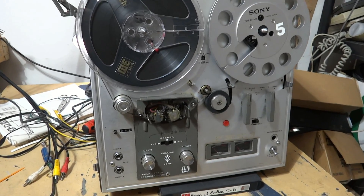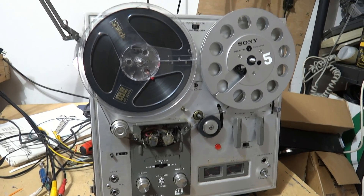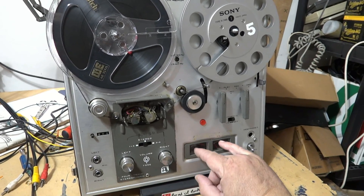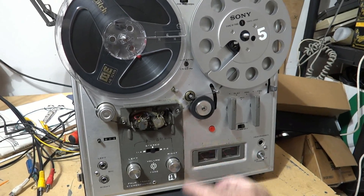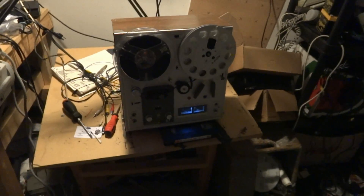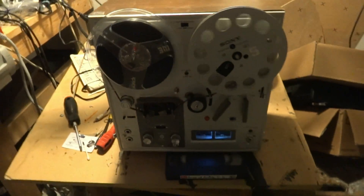There we go — a nice classic Akai 1710W vacuum tube amplifier tape recorder, stereo, still working after all these years. All it needed was a little cleaning of the controls and an upgrade from the light bulb to LEDs. Even though you don't see it here with all the bright lights on, it actually illuminates the meters quite nicely. I've dimmed the lights so you can see the nice blue glow on the meters. When you crank up the volume the meters work with playback, controlled by the volume.